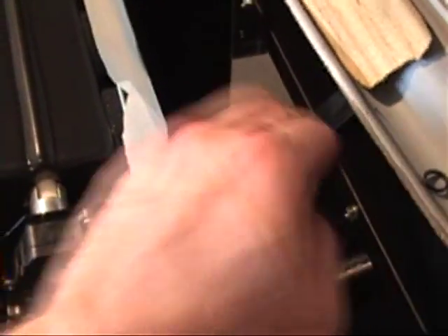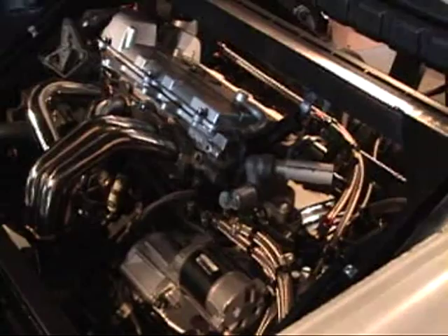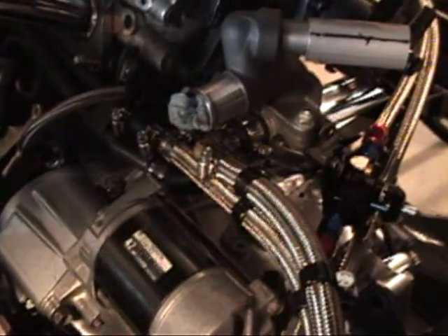Now I've finished mounting up my AC unit and I've finished running my heater core lines. Air conditioner out. I've painted the brackets and bolted it all back in with the thread lock sealant, so it's really stable and good. Now I need to start the plumbing. I've been working out here for a little while trying to plumb up the heater core on the classic air conditioner.